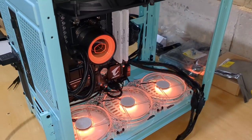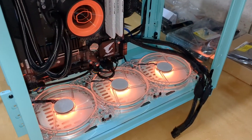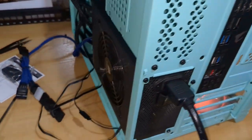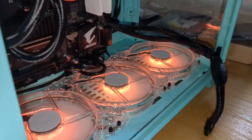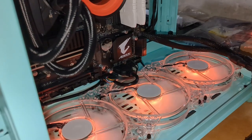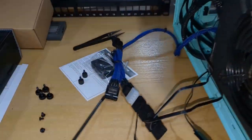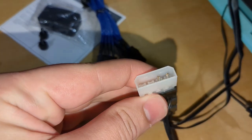For all those people that bought the DIY PC ARGB-Q3 and want to use the ARGB fans that came with the case with an ARGB-capable motherboard — to do that I went through quite a bit of trouble trying to figure it out. There's this really weird behavior where the PC won't boot if you have the ARGB header of the fan hooked up to the motherboard as well as the molex connector connected with the three pins.